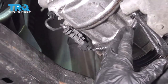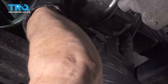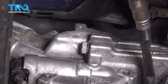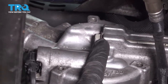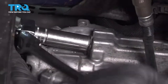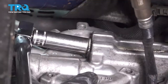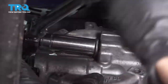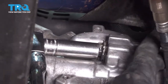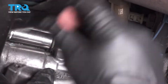Now I'm going to disconnect the electrical part of the compressor — just take a flathead screwdriver, go right in there and pop that off. While we're in this area, we're going to remove the back mounting bolt with a 13 millimeter socket, then move on to the other side. GM slots the actual AC compressor so that when we pull it out from that direction, this bolt can stay right in place to guide it back in.